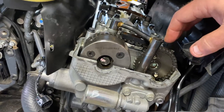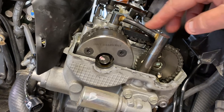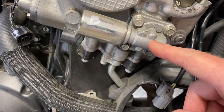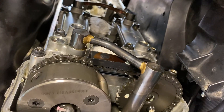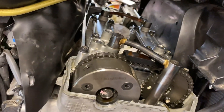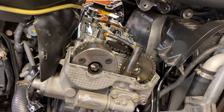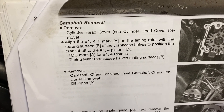That means we've got to pull cams. We'll release the tension on the tensioner right here. I've already taken off two of the oil crossover pipes — this is actually an oil valve for the variable valve timing, and this one is for oiling the cam bearing surfaces. I'll take the remaining one out as well just to get them out of the way so I can accurately measure. Then we're going to refer to the service data — camshaft removal, page 5-17 in the top end chapter. We've done all the preliminary stuff.